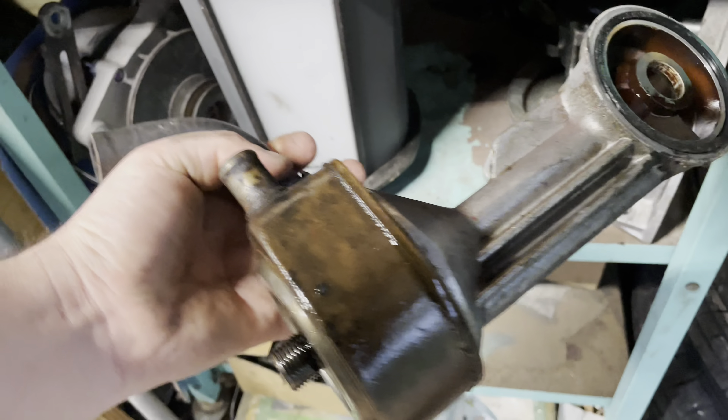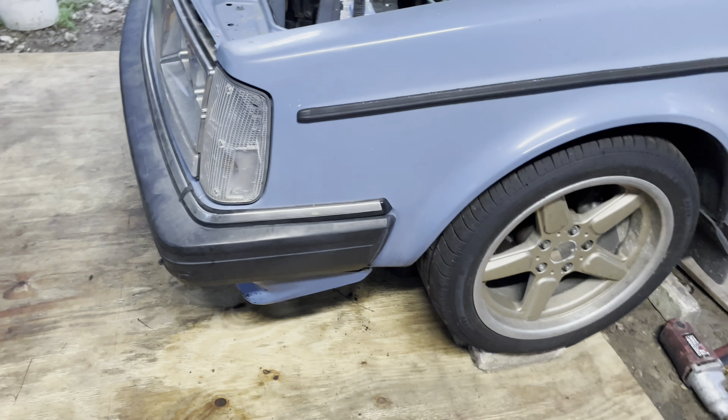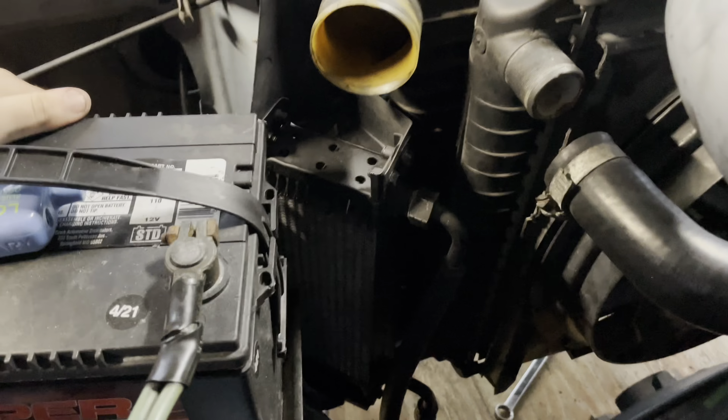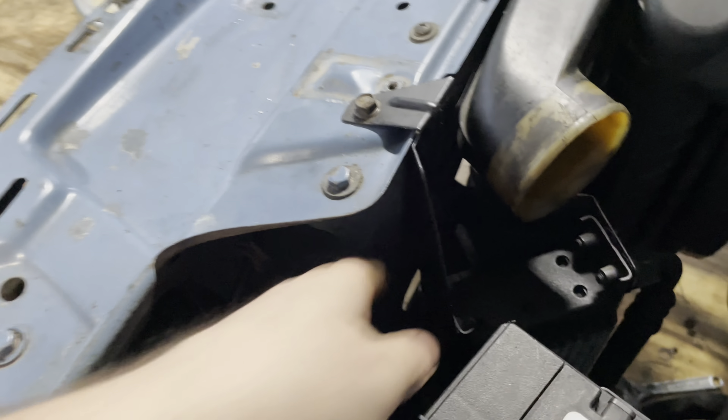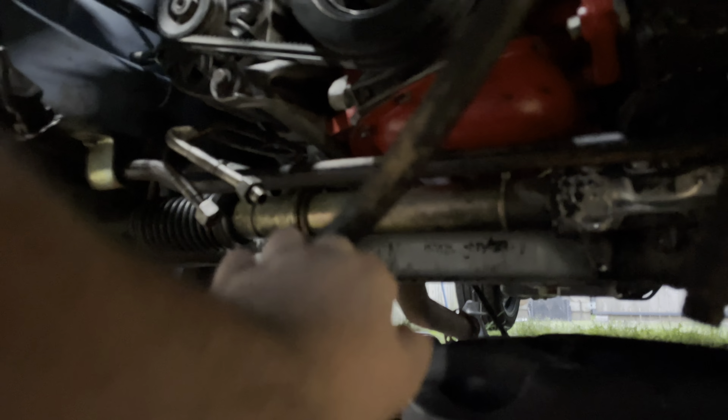I ditched the 940 oil cooler just because a three-inch down pipe is not going to fit, and I picked up an 86 740 turbo oil cooler. It's a little tricky — I had to trim the battery tray, slice the side off of it to make it fit so it doesn't mess with the fins. The lines don't reach, so I'm going to have to get some new lines for it. I want it to be perfect — they've got to go there and they just don't quite reach.